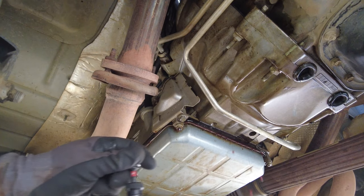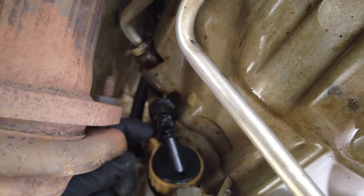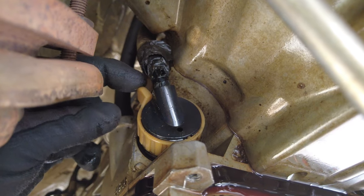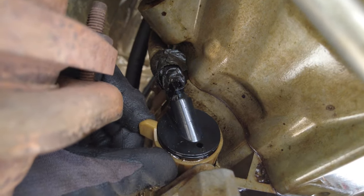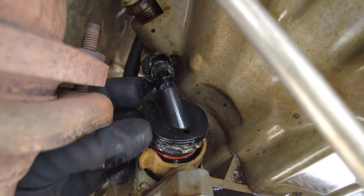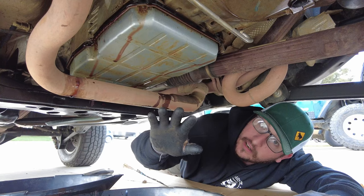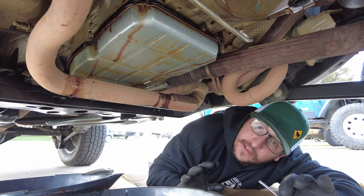I'm going to go ahead and take off this cover plate so we can access that adapter plug. The plug adapter here plugs into the transmission housing. There's a rotational tab right here, and we're going to rotate it in the counterclockwise position and the plug should come out. So I've got the two bolts in the middle and the front taken off completely, so I can get this corner to drop just a little bit to get more fluid out.